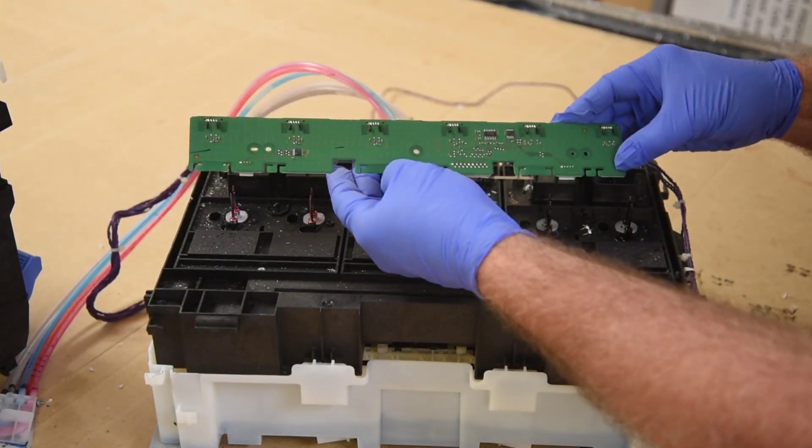I'll remove this white plastic shroud. The ink cartridges don't have anything that seals to it, if I'm remembering correctly. There is a bit of a black ink puddle in a recess here on what I think is the ink holding tank. I think there would be a lot more ink on the top if that is where the leak was coming from. I'll remove this PC board back here. These must be the connections for the ink level sensors or out-of-ink sensors - three connections for each ink. Looks like these six inks are divided up into three dual tank modules.